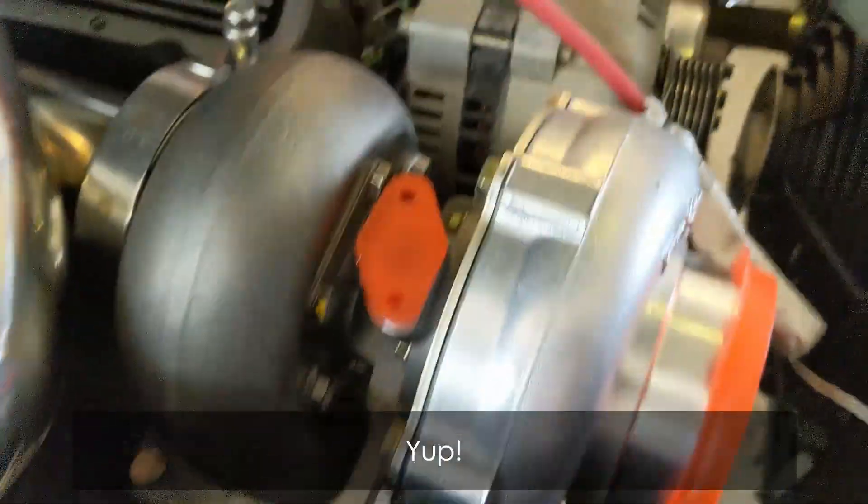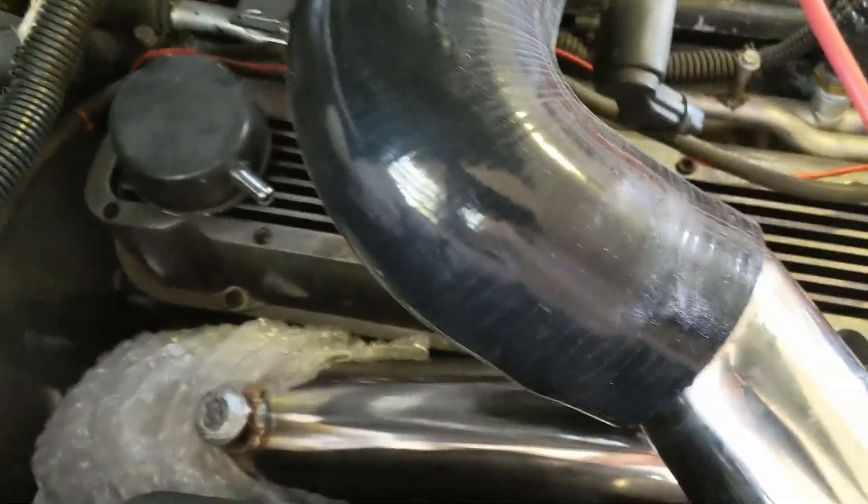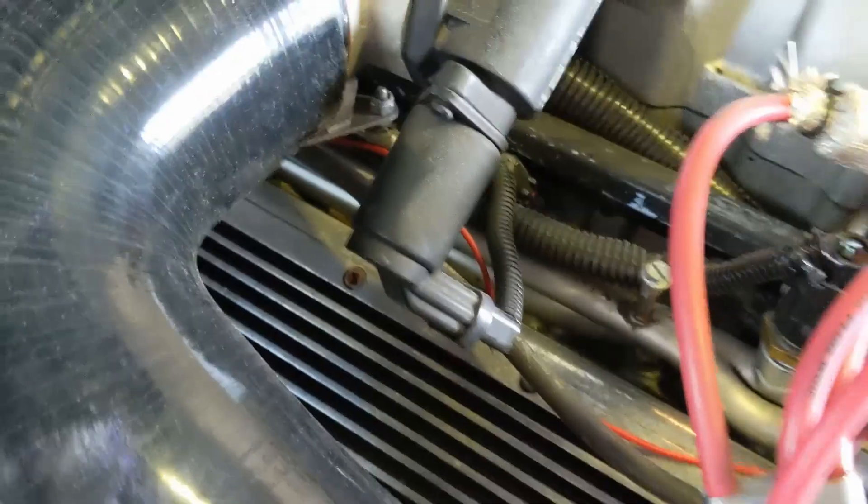My main concerns at this point: I don't have a lot of clearance between the downpipe and the intake pipe, but once I get it wrapped I won't worry about it too much. It's really only going to be under boost for short periods of time and that wrap should take care of the normal heat. The plug wires have to snake down in there in a pretty narrow area, but the wrap will help, plus the plug boots I got are pretty long — they should come up at least to where the downpipe is. I think we'll be alright on that.